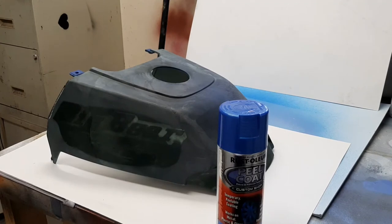I did some research and I had issues with the Plasti Dip with orange peel. I found that you should warm the can up in hot water — I didn't do that, I didn't know that. It was about 70 degrees at the time and that could have had everything to do with my results. It's about 90 degrees in here now in my little makeshift paint booth and I'm about to get underway.